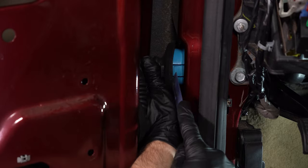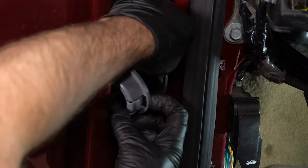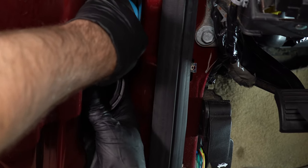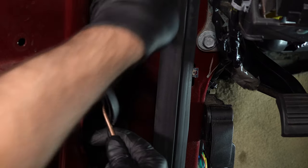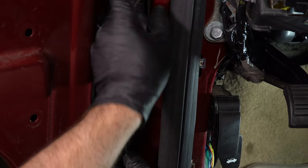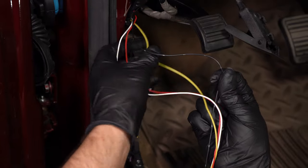You can just push right on there. There's a little tab right there and you pull it — that releases it from that side — and then on the inside right here. If you have to, you can pull these pieces off; it makes it a little bit more movable. We'll put those on afterwards, just push that out of the way. What I'm going to use is a piece of brake line and just slide it through here like that. You can tape the wire to the brake line and then pull it straight through — and we got it through there. Now we can take the tape off.